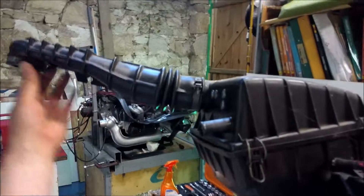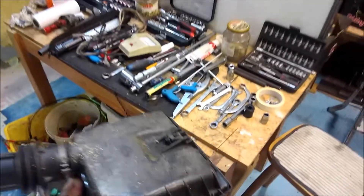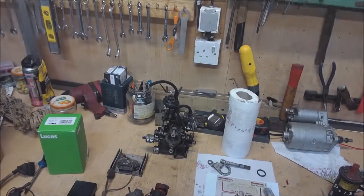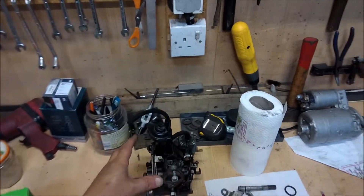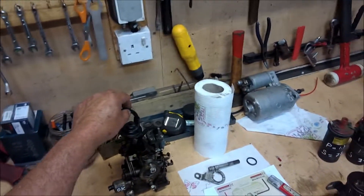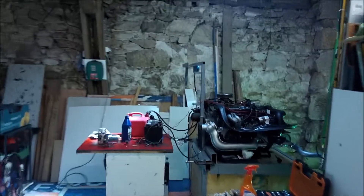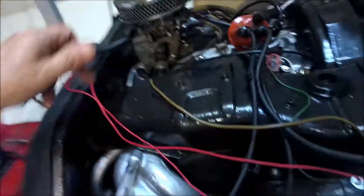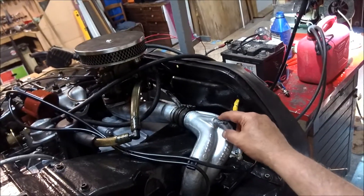The idea was that with this DVDA and a quite complex air cleaner — see, this is the air cleaner that sits on top of the carburettor — it had all sorts of vacuum devices for preheat and also for damping the throttle. This type of distributor and carburettor had all this return valve, anti-cut-off and so on. As you can see it's all been reduced and cut off to a minimum. By the way, if you are reducing everything to a minimum and you have a vacuum take-off to drive the air system and you're removing that, you'll need to blank that off.